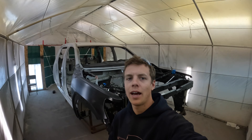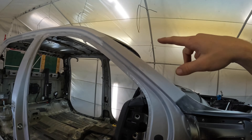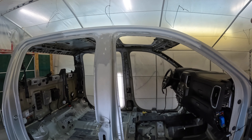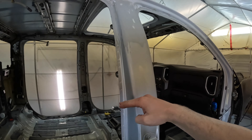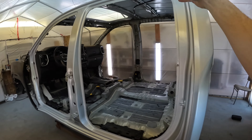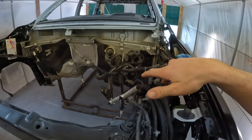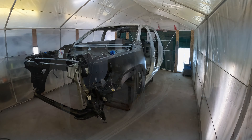Alright, so the body work is all finished up and I'm moving over to the paint booth. I also cut the holes for the cab lights up here, so that's all good to go and they're all cleaned up. Pretty much just start masking this thing off, do a light scuff over everything once it's all masked off, and then we can start putting a little bit of sealer on. I'm only going to seal until about here and the roof, so I can blend all the rest of the paint and then clear coat the whole cab, fenders, and everything.